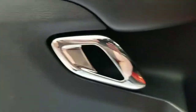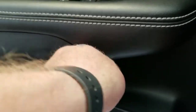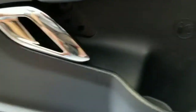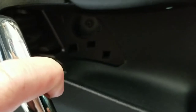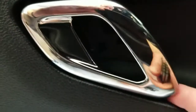Now we're getting ready to pop this off. Where the door handle is, pull the door handle back — a little difficult with the camera. Get your finger behind that plastic and just pop it out. It's just little plastic clips. And then there's a Phillips screw behind there. We've removed the screw in there, behind there, pulled the plastic cap off, remove that one screw in there.